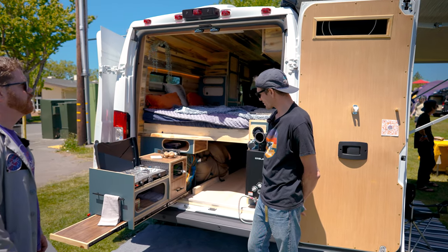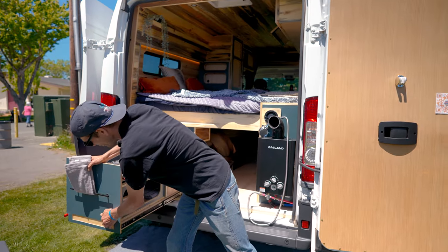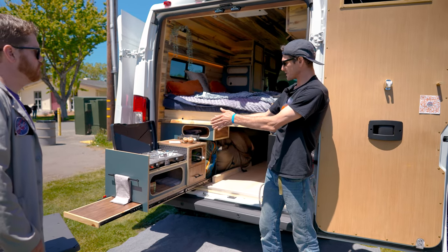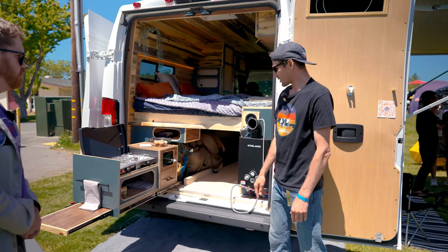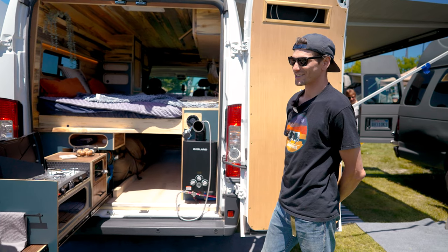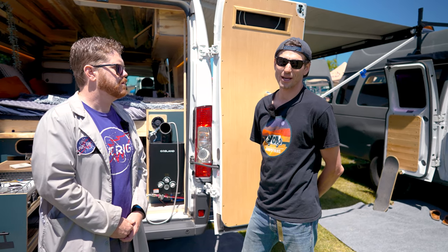What's your favorite part of the van build? My favorite part has got to be the pull-out kitchen. Want to show it to us? It's in the rear — so the pull-out kitchen is a thing we like to put in all of our builds. These heavy duty rails are made by Ovus, an American company. This one's about 40 inches. I like to integrate fun hidden tabletop solutions. The stove is sized to this unit, fits in the top drawer and on the counter, with a separate propane system to keep costs down. There's also a little instant hot water heater — close these doors up and get an outside shower area. You can find us at yolocampervans.com or online at yolocampervans.